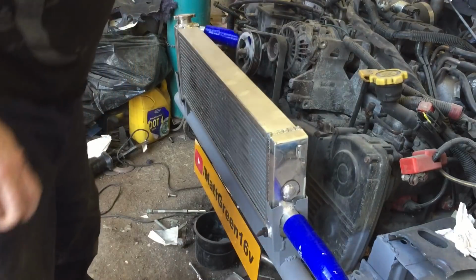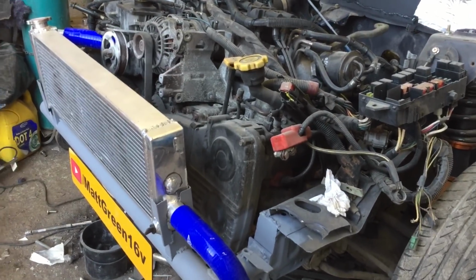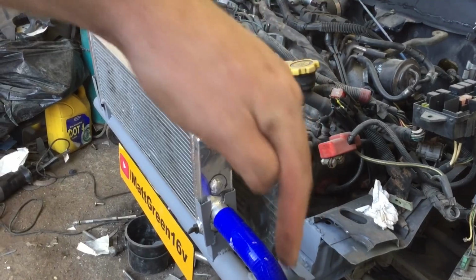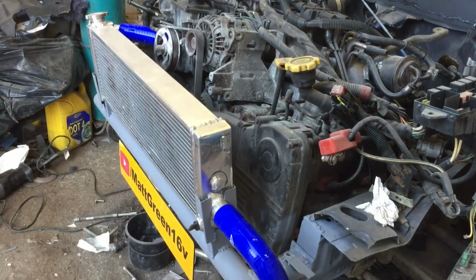We're moving on. So yeah, next job is, let's see if we can get one of these inner CV joints in. They've got, as I said, a little split pin that goes through the thing, so I guess you're going to have to line the joint up on a certain thread and put it on, because if you just put it on randomly, the split pin's not going to go. So let's give it a go and I'll update you in a second.